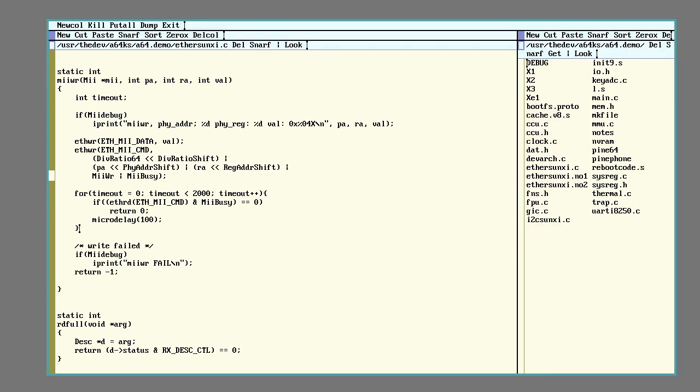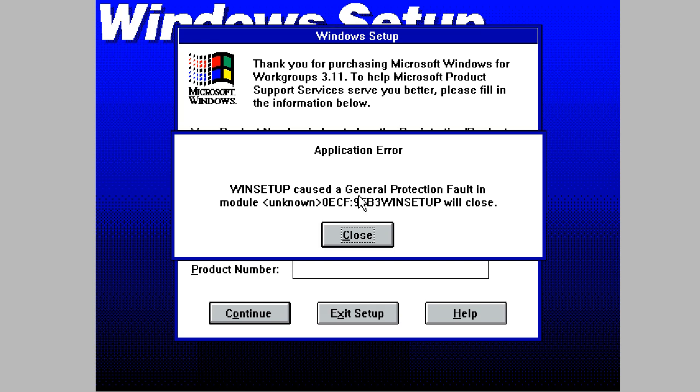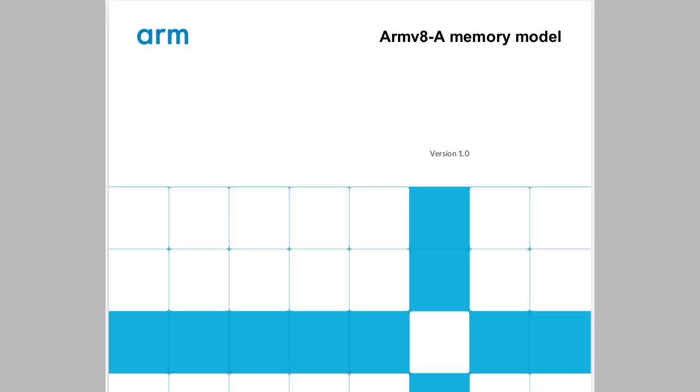So that issue is caching and memory management. If you're old enough or you're into retro computers or consoles, early computers generally did one thing at a time, and so you could just let the one program access the RAM as it pleased. Later, as multitasking became more of a thing, it became sensible to keep one program from accessing the RAM used by another program, or the RAM used by the kernel. So now, all the programs you run are given a virtual set of addresses, which then get translated into physical addresses behind the scenes. This ability was added to the hardware, so every CPU type has a way of setting up virtual memory. This is usually called a memory management unit.